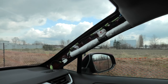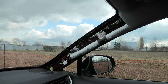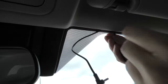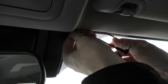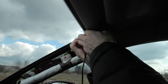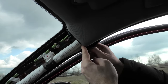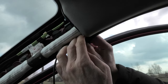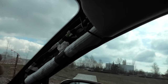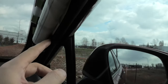We know that a lot of people had concerns about whether installation of the dashcam cable will obstruct the airbag. We will try to imitate a couple of ways to install the cable. If we run the cable this way — say you have a dashcam here — once it reaches this point, normally the wire would take this path underneath the weather stripping, between the weather stripping and the plastic A-pillar cover. This way the wire is obstructing the airbag deployment at least at this point, with the rest of the wire going behind the airbag.